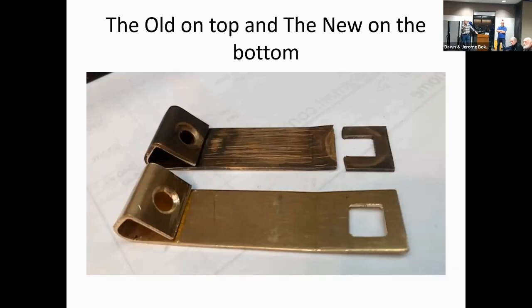Phil, the one you made there looks more brass colored than copper. Is it brassy looking or was it copper? It's brassy looking. Okay. It must be an alloy of some kind that has some elasticity to it. Believe it or not, it's 90 thousandths thick, but it's very stiff. If it was copper, you could probably bend it by hand. It's also a very good heat conductor in an injection mold; it sucks the heat right out of the mold. It's really expensive when you have to buy it for that.